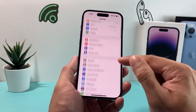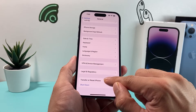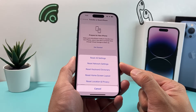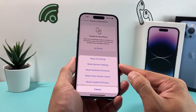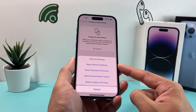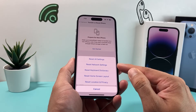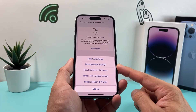After that and you're still having issues, it's time to do a quick network refresh. Go into the Settings app, go to General, scroll all the way down to Transfer or Reset iPhone, click on that, then select Reset, and choose Reset Network Settings. This takes about 30 seconds to a minute and will erase saved Wi-Fi passwords and paired Bluetooth devices, but it's an important troubleshooting step for resolving network-related issues. It will not delete personal data like photos, videos, or apps.